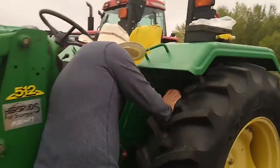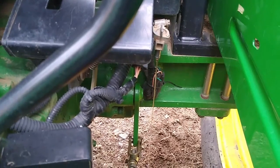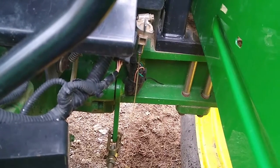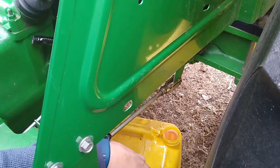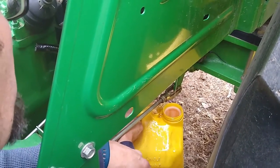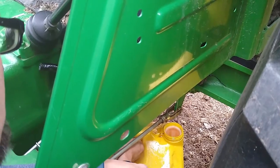I've already loosened the hose clamp, so this is just a simple little soft line. I have the petcock turned off, and I have a little catcher right there. It appears that might possibly be a problem because it is just barely trickling out at all, and that should be like just dumping fuel out. It's a three-eighths line and it's letting about a sixteenth inch of fuel through — it's not even really worth it. I'm not really sure what I'm gonna do next. I might just throw a five-gallon bucket in here to catch more of it because I don't really want it all over the ground.